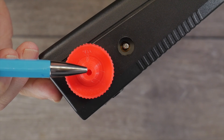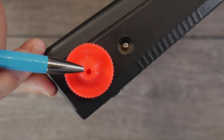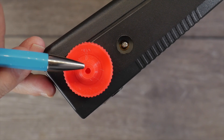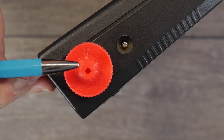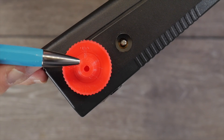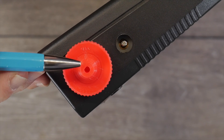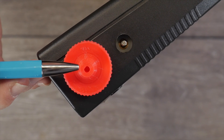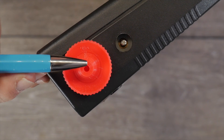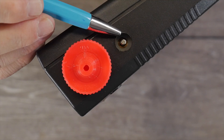The size of the hole when you're printing with thermal plastic can get a little tighter than what you want based on the settings of your individual 3D printer, the slicing software that creates the binary file, and also the kind of filament you're using. So the dimensions included in this file are for this particular setup. If you want to make your own knob for your EP43 typewriter, start with the file I'm going to provide below, but you may have to adjust the size of the hole or the position of the flat on the hole to match the shaft of the platen properly.